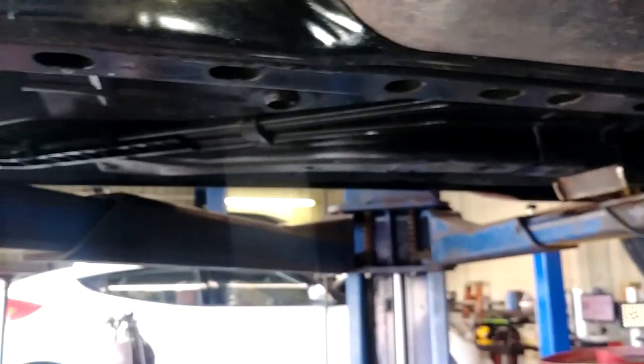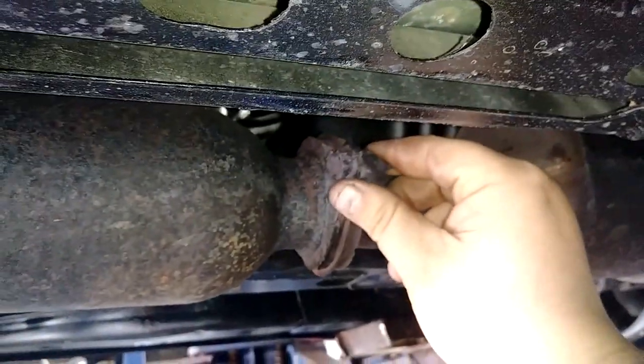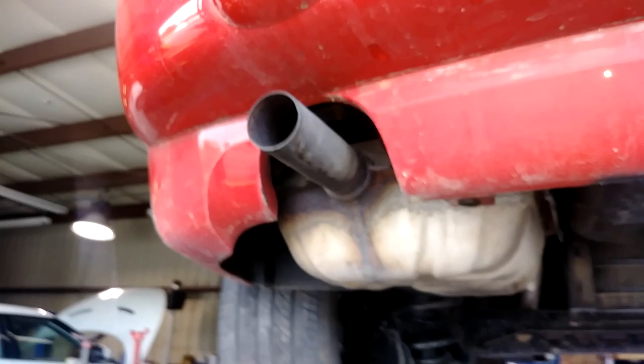We got the part. It's going to fix that — literally just from there to the front of this first cat. But we're also going to cut the exhaust here and here because the last O2 sensor is right here, and we're going to put a piece of pipe in there because this is all rusted up and nasty-looking.